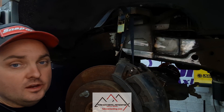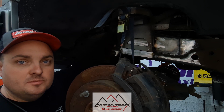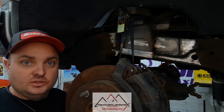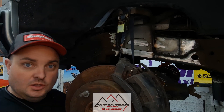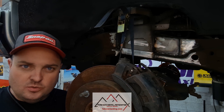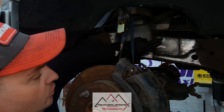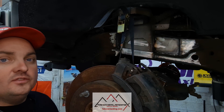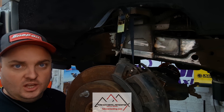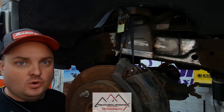We can then infer from right here where the coil springs mount up and set this distance so that we can weld these coil mounts on — at least tack weld — to get a rough starting point. Then when we have the radius arms built enough to hold the vehicle, we'll actually put the coil springs in and lower it down to see where it actually sits, because things change. Geometry slightly changes the way springs compress. So this is just a starting point, with strong tack welds on both sides — strong enough to hold the vehicle's weight temporarily, but not so strong that it'll be hard to cut and adjust the height if needed.